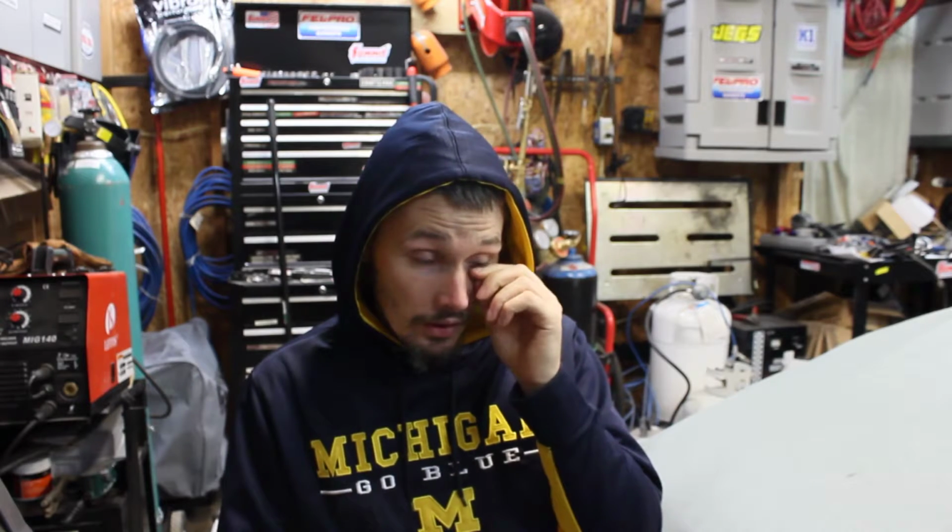What's the other thing? We're probably going to be looking for new wastegates. I don't know about these China wastegates. They're cheap, but I don't know. Like I said, I'm getting boost creep, and I got two 38mm valves, which should be more than enough for this 4.6, 281 cubic inch engine to be able to dump off enough pressure. But for whatever reason, whether it's in my tune or what, it's creeping up higher than it should.